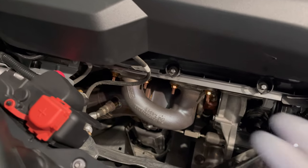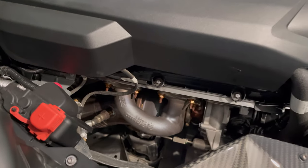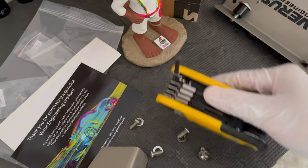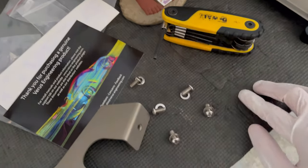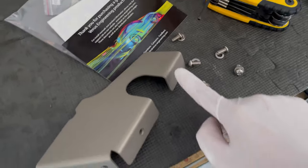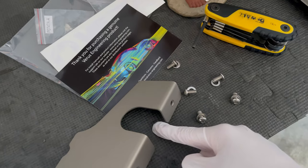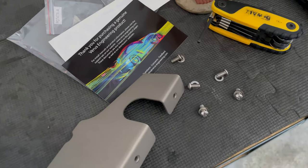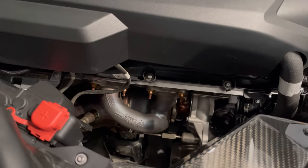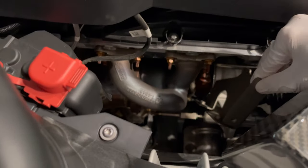Let's install the piece that goes over your wastegate actuator. Here's my DeWalt tool — I think it's a 4mm allen head — used to remove these four fasteners. Remember there's a spare one in case you lose it. Take these four out, and carefully slide this piece over the wastegate actuator without scratching any carbon or banging anything up.